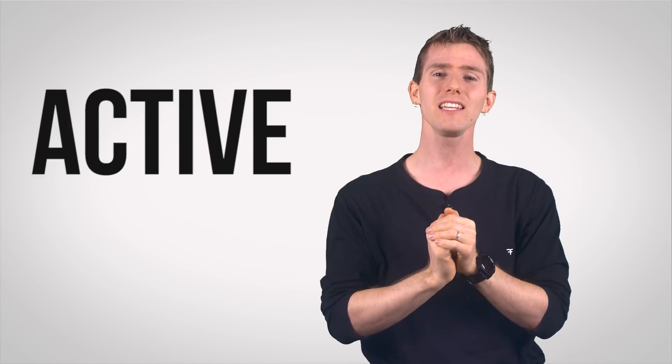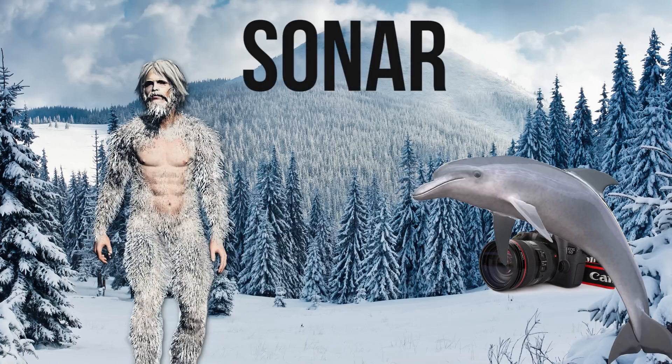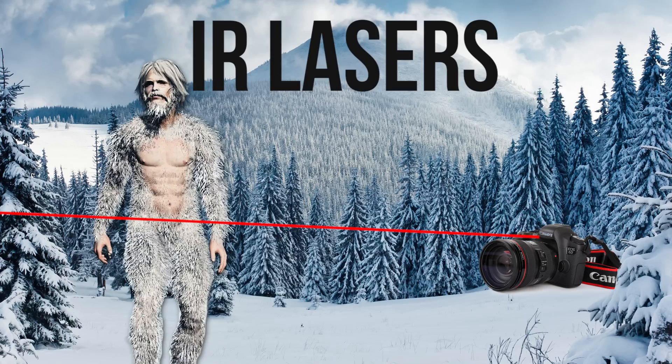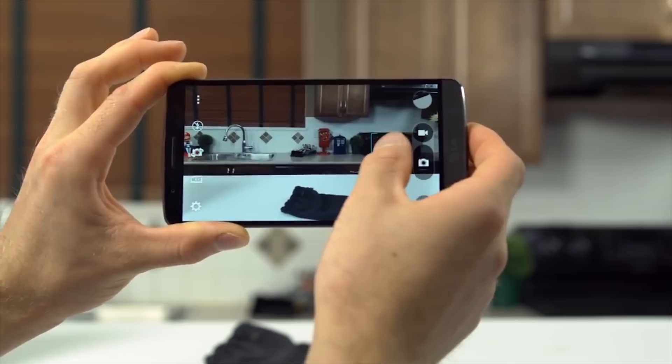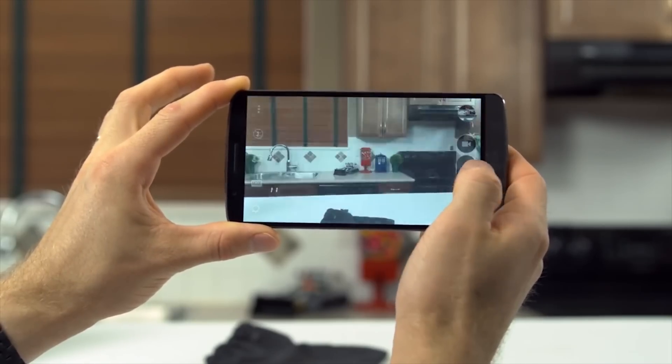Active autofocus was a bit of a tease, since applications of active autofocusing tend to be on the less-than-practical side so far. These devices work, in theory, by physically measuring the distance between the camera and the subject, operating outside the normal functions of the optic system. Two implementations have been seen: sonar, which uses audible clicks to determine distance to the subject — just like dolphins — and infrared lasers, like the one found on the LG G3 smartphone, which use a constantly measured distance to triangulate the space between subject and camera and adjust focus quickly on demand.